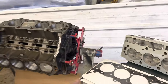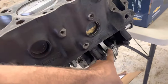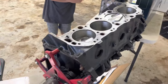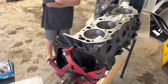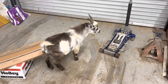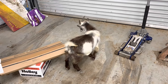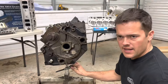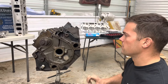If you watched the earlier videos, you'll know this engine has hypereutectic dome-top pistons — cheapo ones — and Chinese H-beam rods. We just threw them in, didn't balance anything, reused the stock block, reused the stock crank, and put new bearings in. Go back and watch the old video to see what we've done up to this point. We've got Rocky in here for quality control — he checks clearances and cleans parts before we put them on the motor. This motor has been hanging out on the stand for at least six months in a trash bag with oil on it to keep it from rusting.